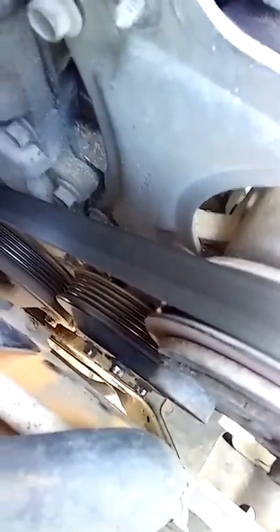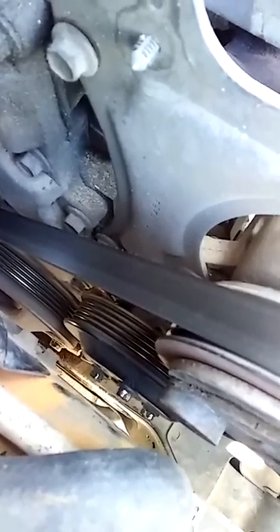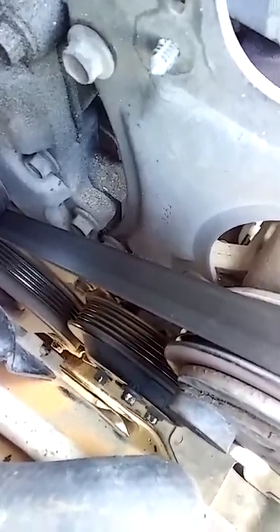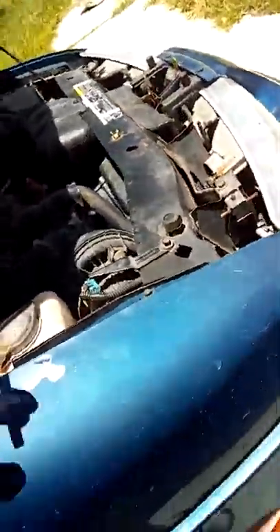It cranks and runs, she's good to go. I tried and tried but you cannot break those nuts — I stripped them. So I'm gonna have to get a cut-off or deburring tool and just grind those bolts right off the top. The water pump right there, you can see them. I tried everything in the world to get them off and couldn't — the pump leaks like crazy.